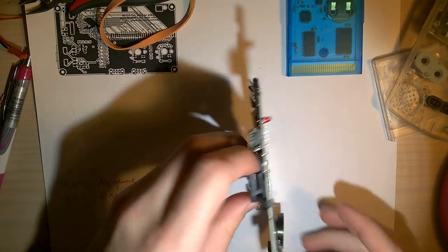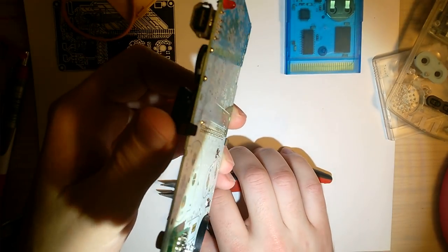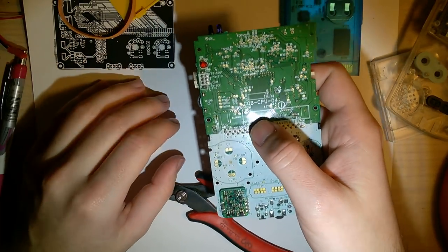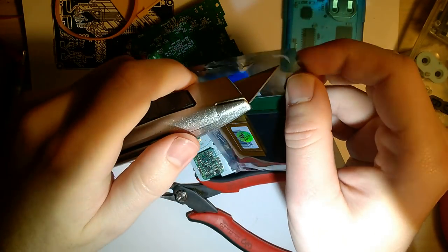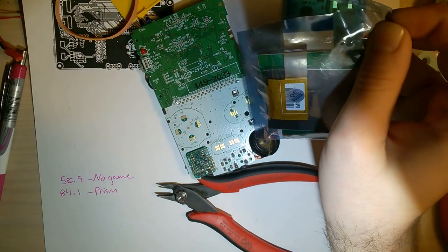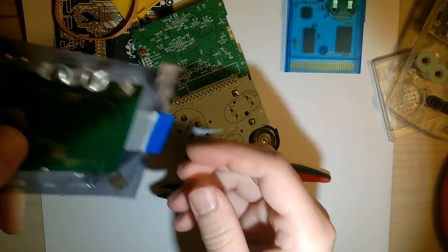Okay. So, the first thing we need to do to install Freckle Shack is we need to trim these cart reader pins down here at the bottom. They stick out quite a bit and they will short against the metal housing of the screen. Or actually, I think what happens is, let me just open this up. I think what happens is the motherboard itself ends up bumping up against them, and then the screen doesn't sit flat because that's leaning on it and so on and so forth.